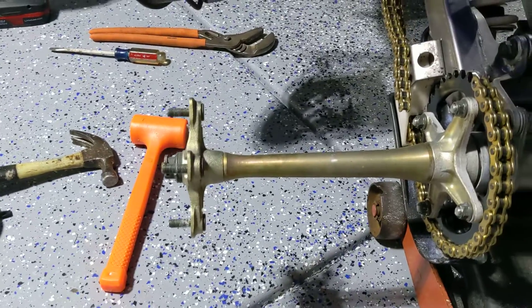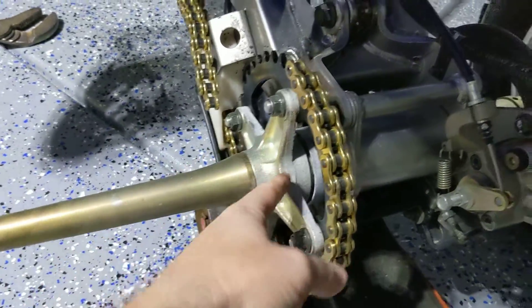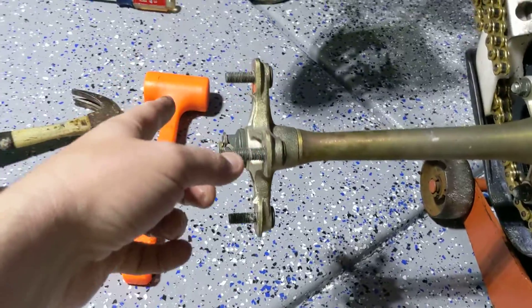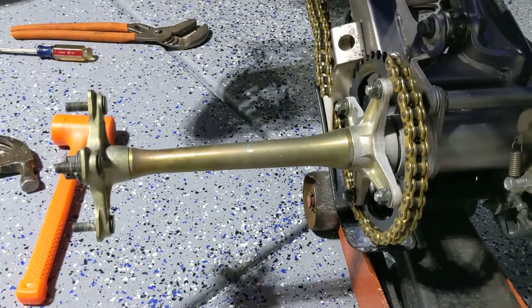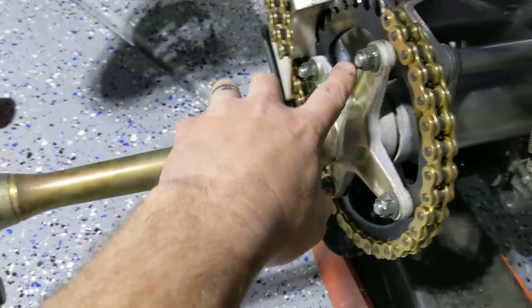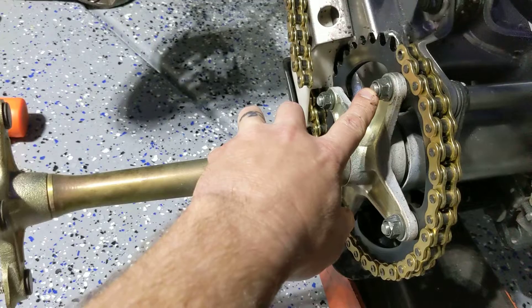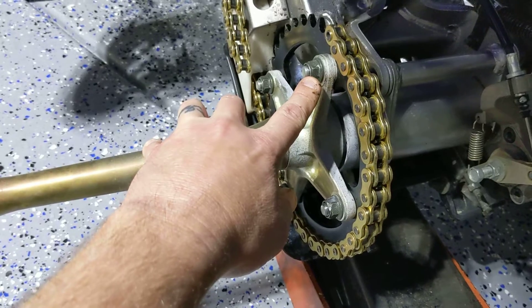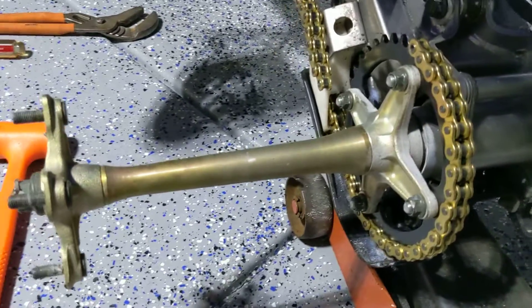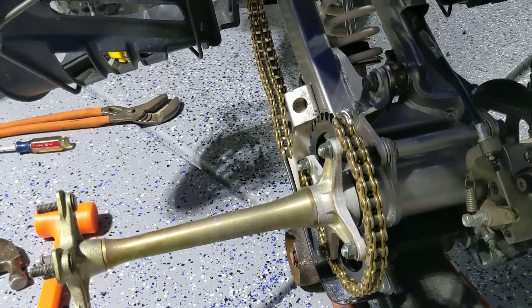If you've never changed sprockets before, it's super easy. The way the sprocket is cut out and designed, once you unbolt those four bolts, it's just going to slip over the inner hub and then slide over the outer hub — but you've got to have your wheel off. I'm not 100% certain on the exact torque specs for the rear ones, so I made them snug with the cordless impact and then used a little bit of blue Loctite. These nuts are lock nuts anyway, and they're like 14-millimeter bolts, so pretty snug and then some blue Loctite.